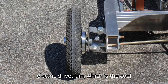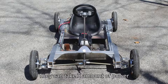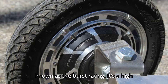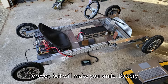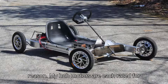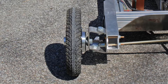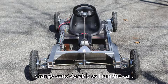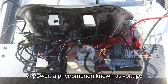Now it's time to discuss the electric drivetrain, which is the cool part. All power electronics have ratings — they can take X amount of power continuously for the rest of time, or Y amount of power for a shorter time. Y is known as the burst rating. It's a high level of output that cannot be sustained forever, but will make you smile. Battery and inverter manufacturers will often state a burst rating, but motor manufacturers will not, for whatever reason. My hub motors are each rated for 2.5 kilowatts of continuous output — that's 3.35 horsepower, 52 amps at 48 volts. The voltage will not change considerably as I run the kart, going down a little when I ask for a lot of power, a phenomenon known as voltage sag.